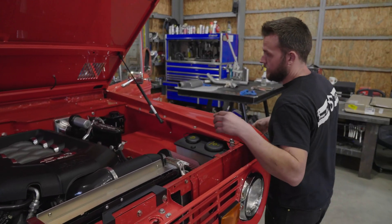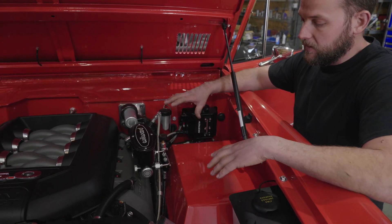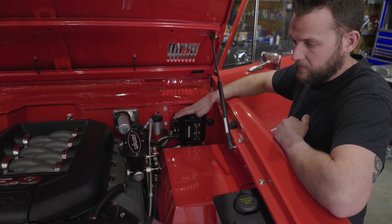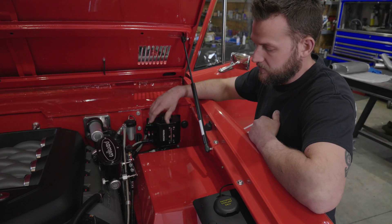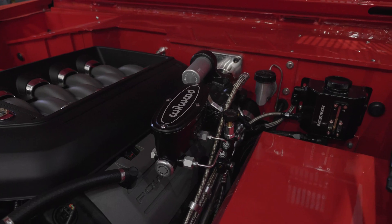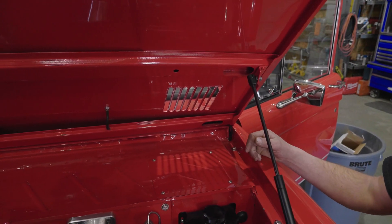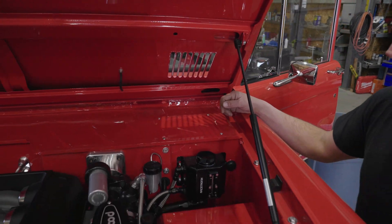Another unique feature I really like — we used the Hydratec hydro assist power brake unit, a very tight small unit. We basically bought their kit, threw all the plumbing in the trash, and started from square one with our own custom plumbing. Racetronics, a great company out of Canada, supplied the reservoir for the power steering and hydro assist unit — it plumbed up really nice. We tucked the lines tight to the engine, and under the panel we put all of our electrical, easily accessible and weather sealed to the top of the cowl.